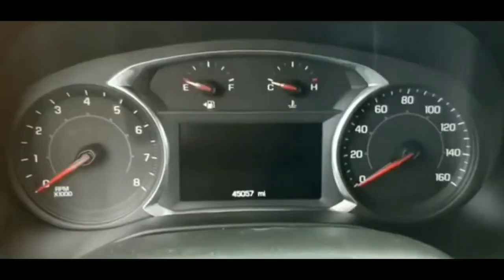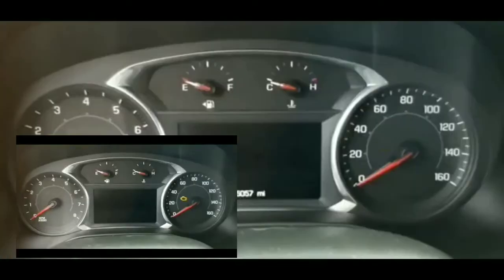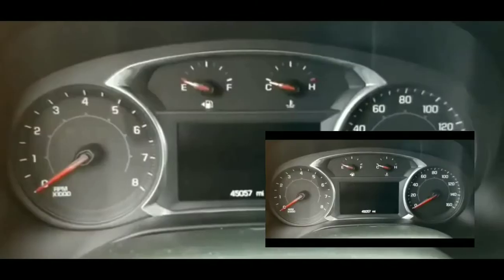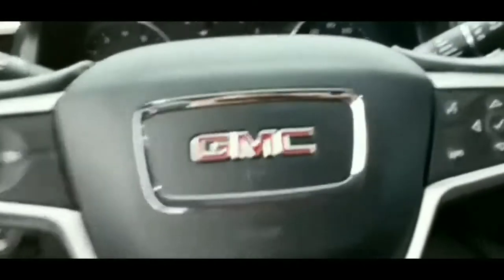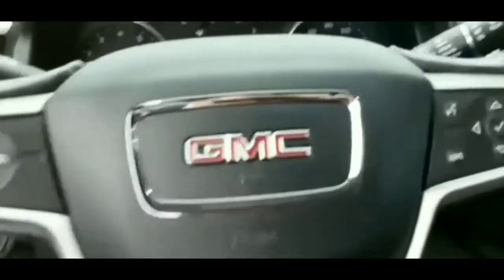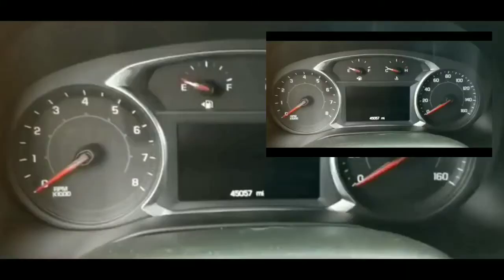So what I did was I did open the hood up, obviously. Before I got it jumped, I was doing a couple of things. I checked to see whether the terminals were rusted or had any kind of debris on them. It was kind of dirty. I did unscrew the connections to the terminal and cleaned that up a little bit with paper towel, to try to wipe some of it off. I sprayed some WD-40 on it. I actually had a can of soda also, and I poured some soda on it and pretty much wiped it off with some paper towels. It's a lot cleaner than it was before. It's pretty clean now, to be honest, and it should be making good contact.